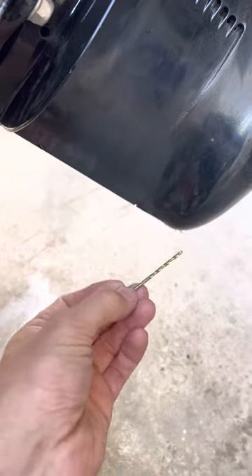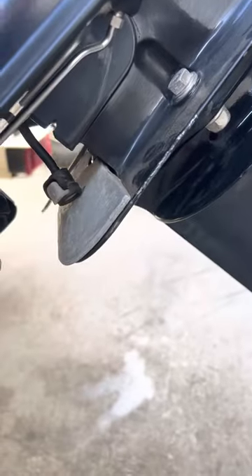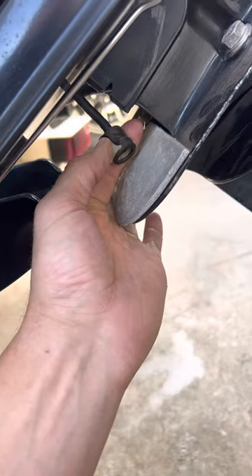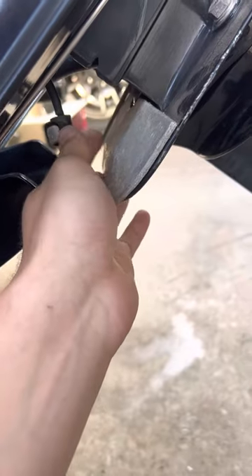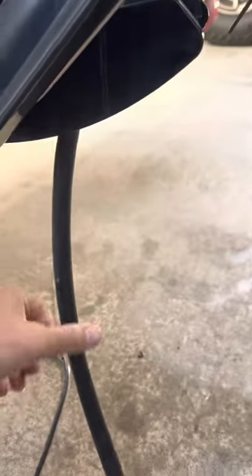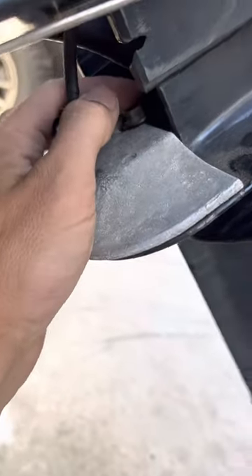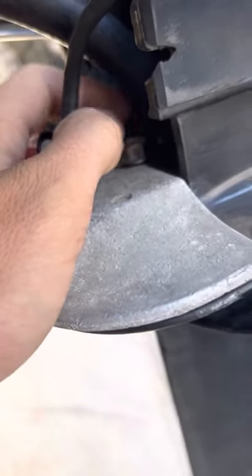But there was a little bit still lodged in the system because we hit that thing pretty hard. The other thing people recommend: this is the connector that goes back up to the speedometer in the boat. You push this little button and pull it right off to disconnect it. What I did is take a half-inch heater hose — that's what I had in the shop — and it slid right over pretty snugly on that connector. Then I just threw a zip tie on there to snug it up.